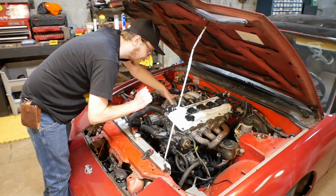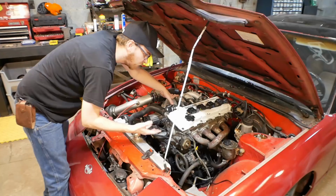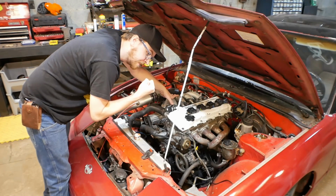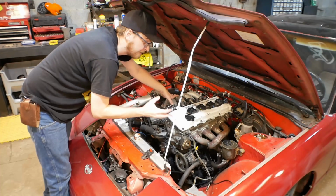So from basically the moment the computer turned on, these coils were gaining dwell. Dwell meaning it's basically building up the energy inside of it so that at the moment of ignition, it can release that energy and create a nice spark. The reason for that isn't easy to explain. There's a lot going on at play as to why that would or wouldn't work, and there's a lot that we just frankly don't know.